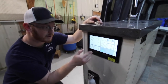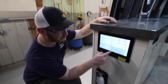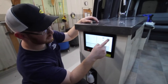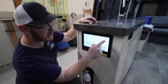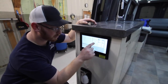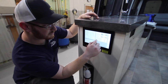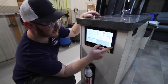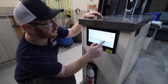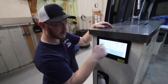You have an off/on switch to turn the solar charger completely off or on. Under settings, you can see the temperatures, panel voltages, historic amps for today, yesterday, the day before, past week, and total. You can also clear the history. The max rated charge voltage is 24 volts, charge current is 30 amps, and you have 1,200 watts max rated power with a max panel voltage of 100 volts. You don't need to worry about changing anything here.